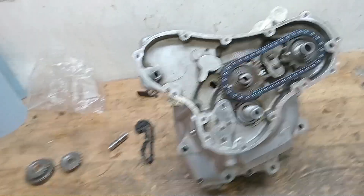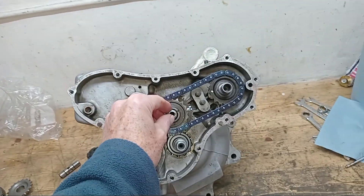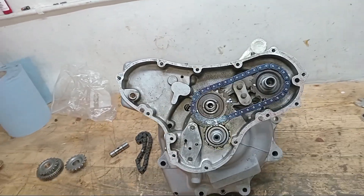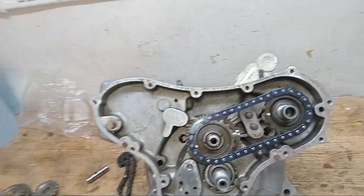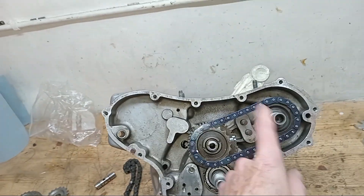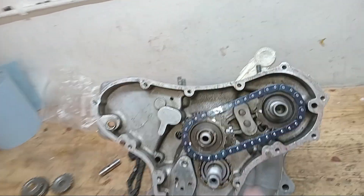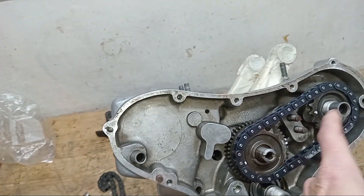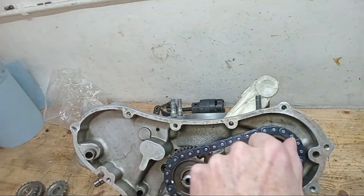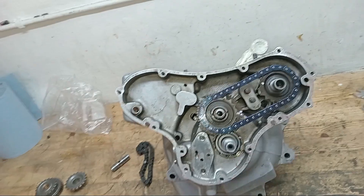It was to excess - I couldn't live with it. So the question was: what's the problem? I couldn't work out what it was. The only obvious thing would be that the camshaft is running eccentrically, but it seems to be fine - it'd just be the end that's bent. If the whole thing was bent then obviously it'd be tight to turn, but it's smooth and fine.